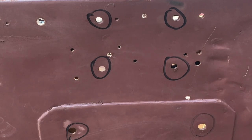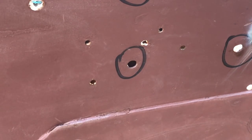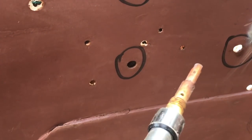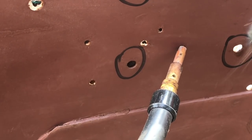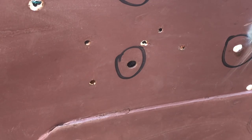The idea again is you're going to put that copper spoon right flush behind the hole you're welding up, and the weld will not stick to the copper but it will stick to the sheet metal and fill the hole. So basically what I'm going to do is put that spoon up against the hole nice and tight so the weld doesn't stick to it, then take the wire on the MIG welder and give it a nice short hot burst — starting on this side of the metal and working back to fill in that hole. It's really simple. Let's give it a go.